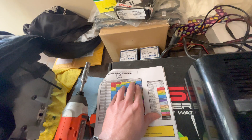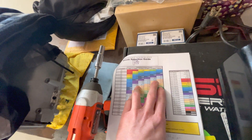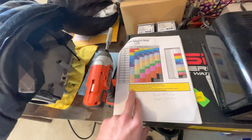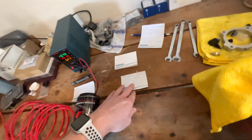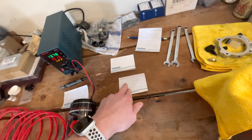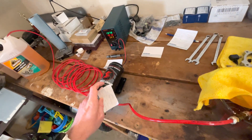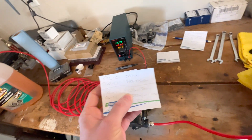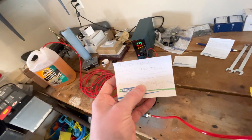I'm running in the 21 to 24 psi range, and arguably I'm around 550 horsepower. Their chart says something like 10 to 12 gallons per hour; I just jumped up and went for a 12. They do say to reduce slightly if you have an intercooler — I just chose 12 because I had it in stock. The main reason: if you have a number six maxed out you're doing 775 milliliters per minute, but with a number 12 at minimum setting — running 6 amps instead of 9 — you're also doing 775.